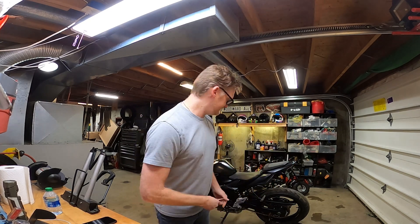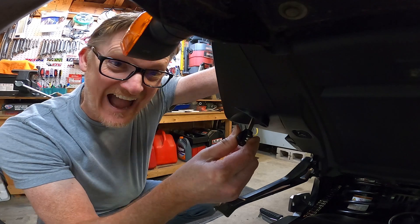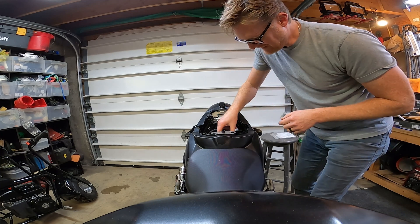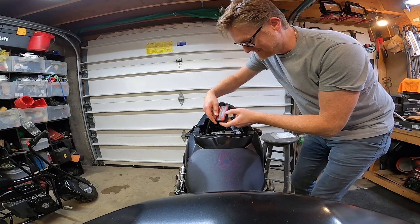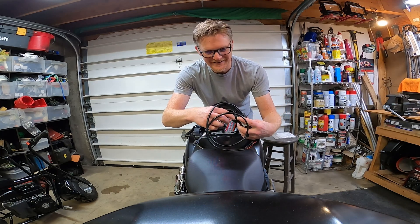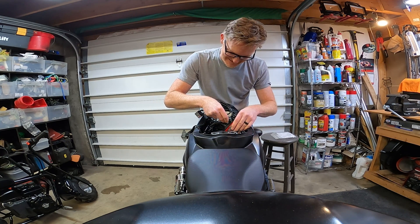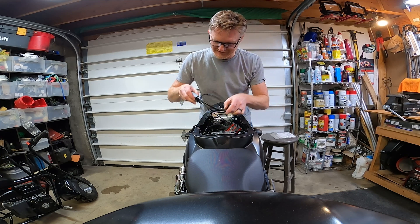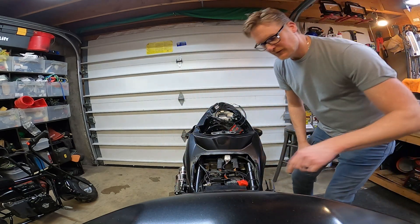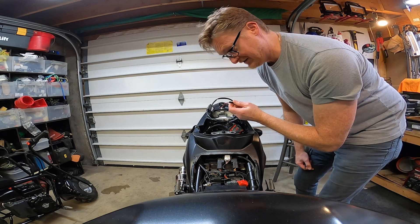For this I need this very important tool — there's a port here this key goes into and then I take my seat off. This is where I put my power commander. I Velcroed it to my toolbox. There's the port — we plug the CAN cable into it, done, and we plug it into the power commander. Nice solid connection. Taking the seat off so I can access the battery, because I'm going to use the ground on the battery side for the ground on this.